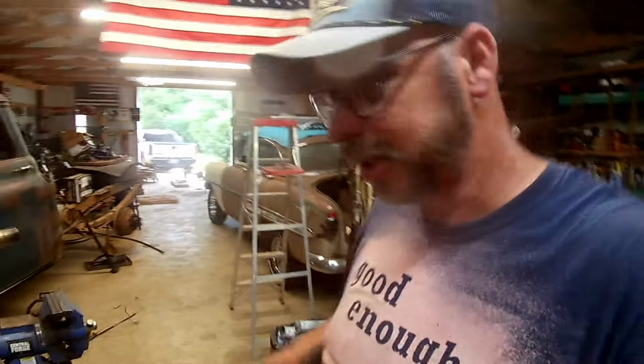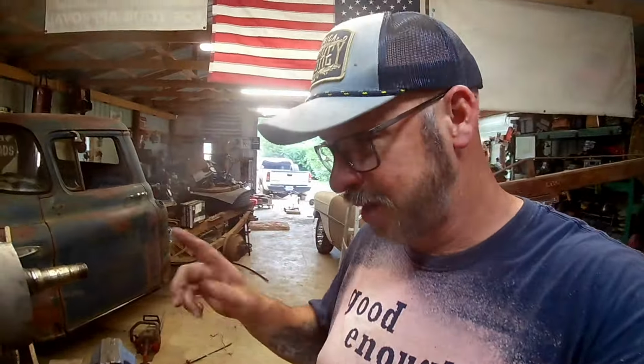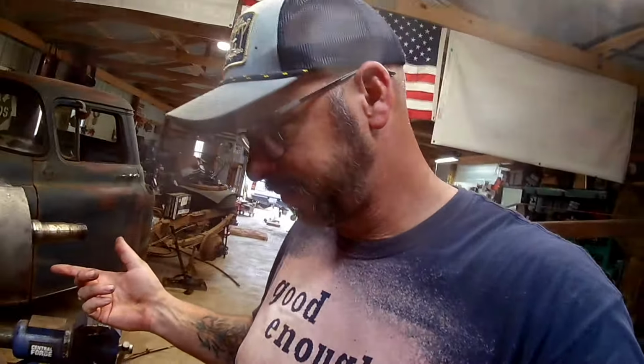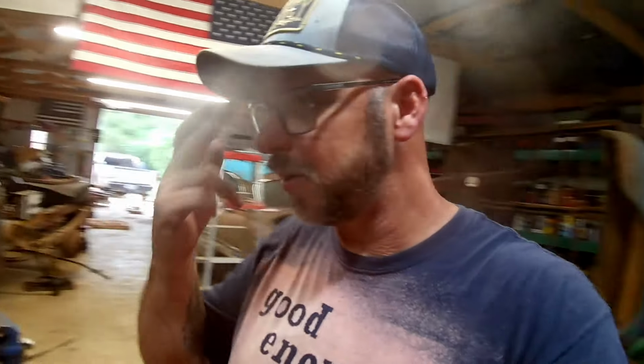And I was just going to clean up, like hose off the bearings and the hubs in these drums and just run them, but one of the bearings fell apart. So that led me to doing bearings. I was already going to do seals, but that led me to doing bearings. I mean, it fell apart. The outer bearing just came apart and came out the end of the drum.